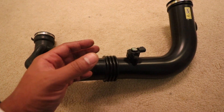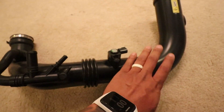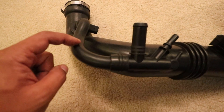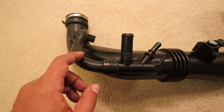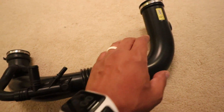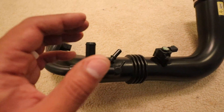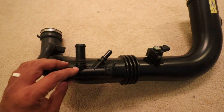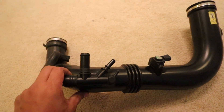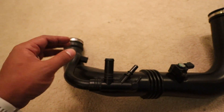This tube wasn't designed that well — it actually robs my car of performance. For one, it's made of plastic so it absorbs a lot of heat. Number two, this mini air intake tube is known to crack or break, causing check engine lights. Previously the only way to replace it was to replace the entire tube, though now there are third-party resellers selling just the mini tube. Also where the sensor sits and where this piece connects to the main pipe, there are a lot of micro leaks — and I definitely don't want that when I want optimal air going into my turbo.